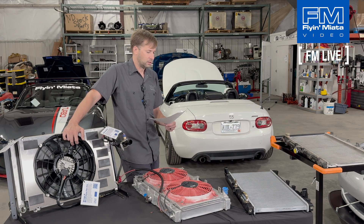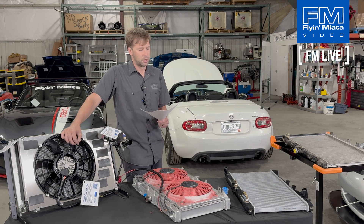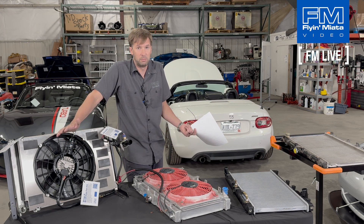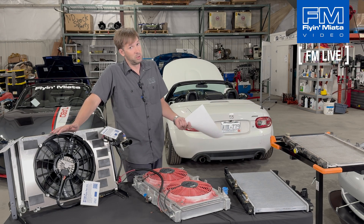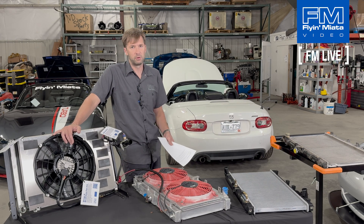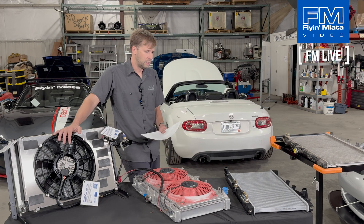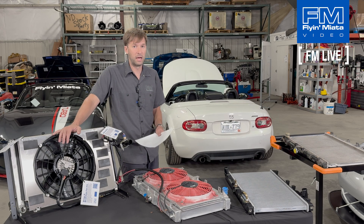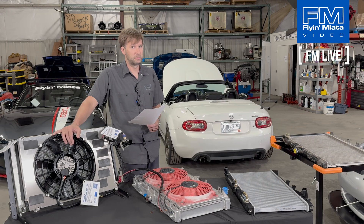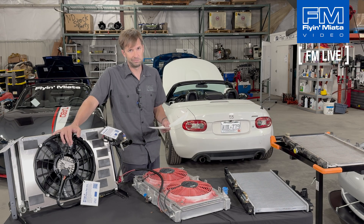Question: what is the difference between eBay aluminum radiators compared to other big brands? You know the phrase — you get what you pay for. I can't speak to the quality of eBay aluminum radiators in one direction or another; they don't give me warm and fuzzies. They're very much going to be duplicates of the stock radiator format. My guess is that there's not a lot of engineering into what kind of tube and fin count is best or what fin details will shed heat most effectively. Also, our customer support department is here — good luck with eBay's customer support if you have any issues.